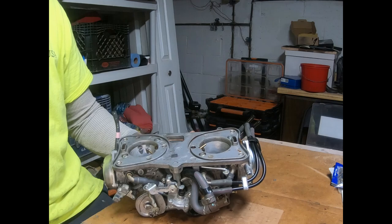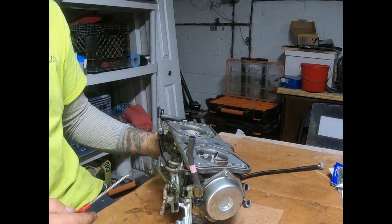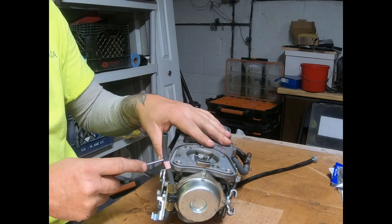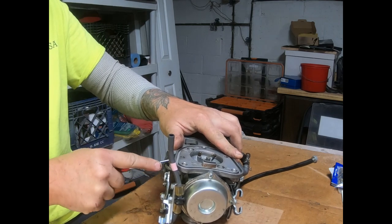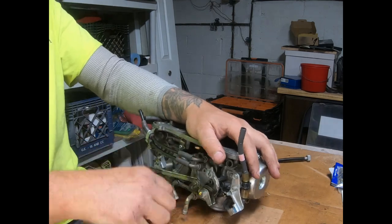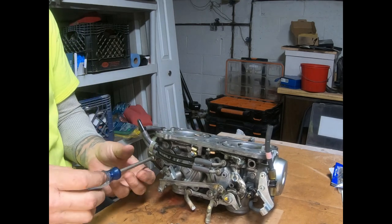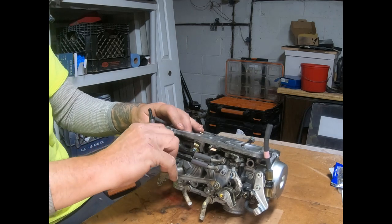The first thing I do is buzz around this whole thing and take off all the vacuum hoses and all that stuff. I would recommend you take a picture of all sides of it - there's a lot of hoses and you want them to go exactly the same way. I've taken my pictures already and I'm just going to start pulling hoses off, cause we got to get this thing down to bare metal. I also gave it a little pre-bath - soaked it in lemon juice, baking soda, dish detergent, and hot water while I took my daughter to gymnastics, just to get some of the outside crud off. If yours is all crudded up, you might want to think about that.